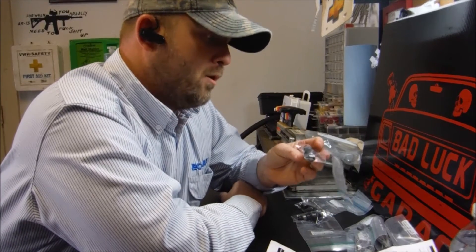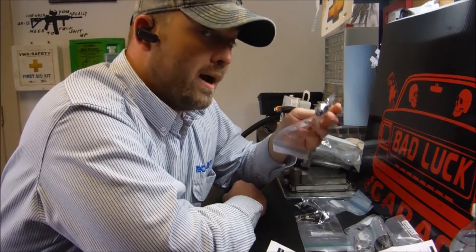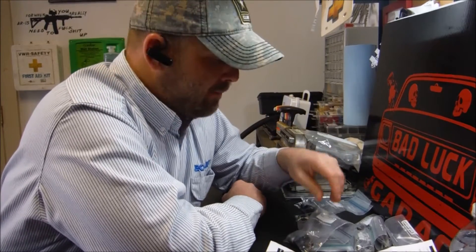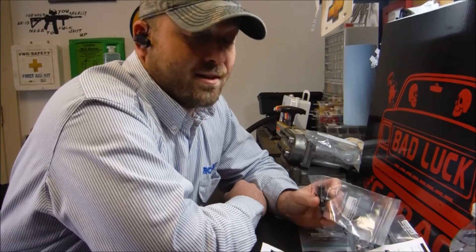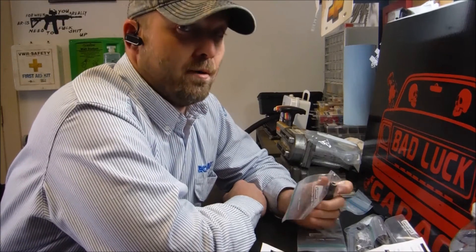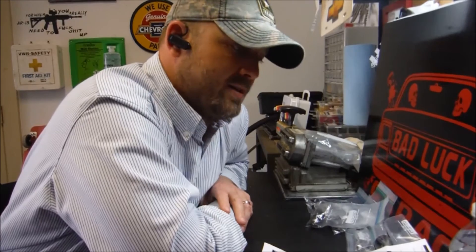A friend has a set with a different part number — I looked his up and they're rated at 24-point-something pounds. So these were actually the highest flowing ones, factory rated. According to Eric, once they're decapped they're all pretty close to the same, but I want to keep the part numbers the same — or I might not. I might talk to John. The six liter we're going to be building for John's LS project is actually going to be turbo — big turbo, probably. He's got a T66 and a 90 millimeter turbo. He's wanting to put the 90 millimeter on there, so he's not going to be able to use stock injectors anyway. At some point we may just send his and see how close the flow rate is, and I might just say OCD be damned.